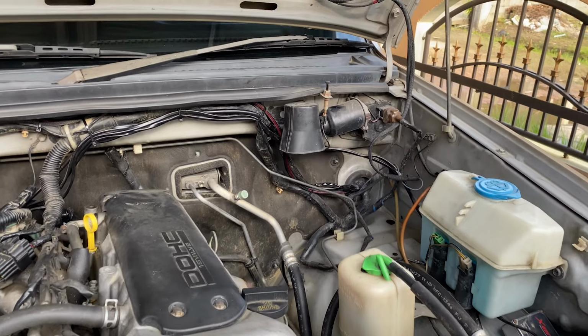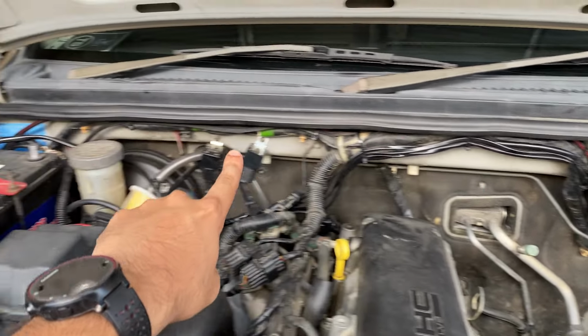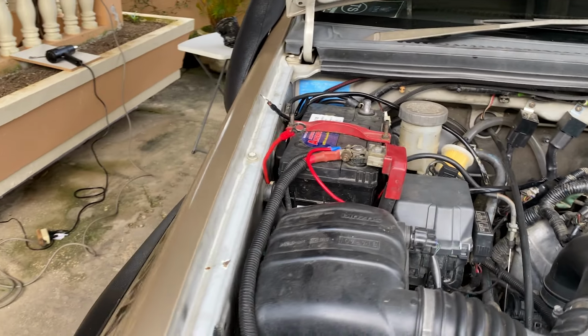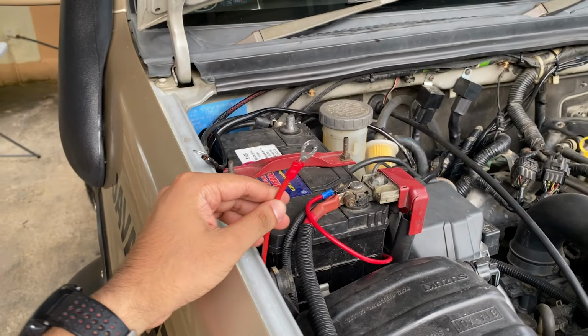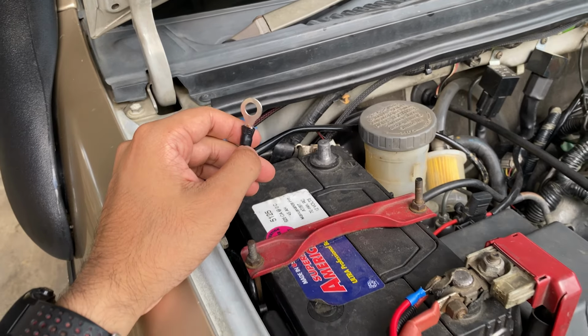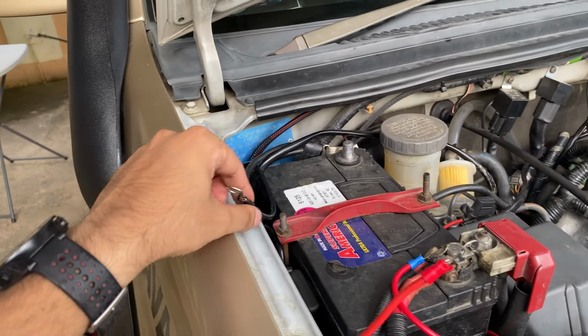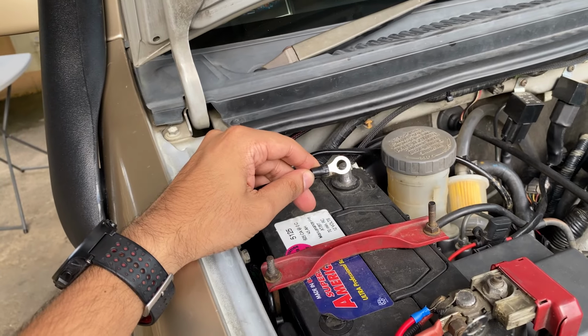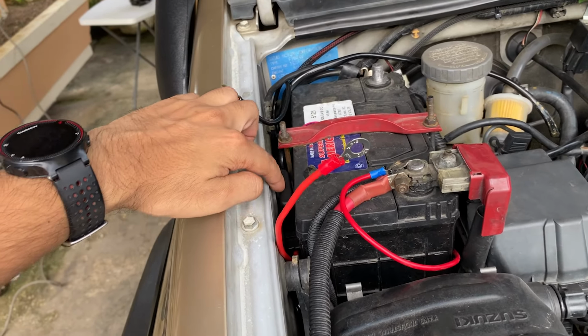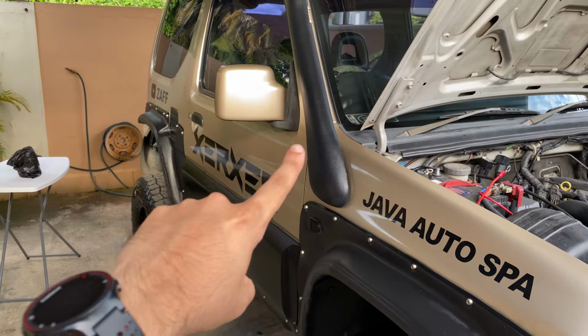So just finish around the wire, and from the grommet there we go up and across to the battery. Now at the battery we have the positive wire and the negative wire. I crimp on some ring terminals, so the positive wire would connect to the positive terminal and the negative wire would connect to the negative terminal. And I have the fuse tucked away nicely in here. So next is the wire up the switch.